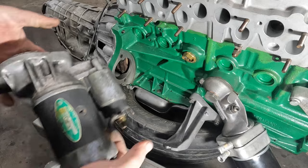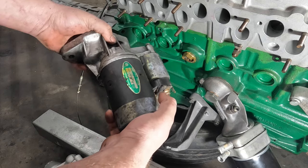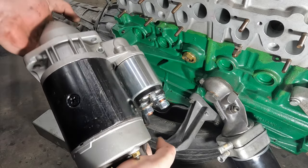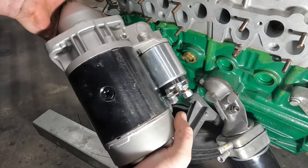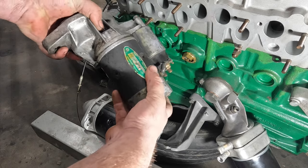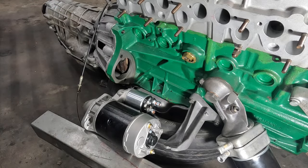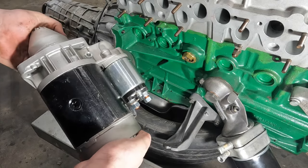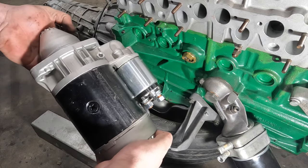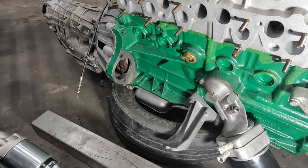Since this is an '86, it would have come with one of these newer Hitachi starters — these have a smaller motor and are geared down further. Earlier models, I believe '82 to '84, came with a Bosch direct drive starter. The internet seems to agree that the Bosch is the beefier unit, being a direct drive with a much bigger motor. They both put out about the same torque, but since the Hitachi is smaller it runs faster and is stressed a little more — it's a lot more susceptible to heat soaking and exploding. So we're going to throw in one of the Bosch units. If you want one of these and you're sorting by vehicle, look for a starter for an '82 to '84 242, 244, or 245 NA diesel.